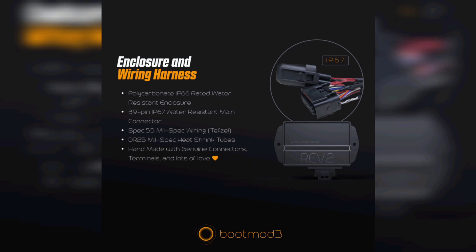They also increased the inputs and outputs, giving it a lot more capability for things it can control and data it can read to operate everything safely. It is IP66 certified, validating it for certain amounts of dirt and water intrusion — basically designed from the ground up to be mounted in your engine bay. Now, there are two things merging together here: the Rev2 board that does all the controlling, and the Custom ROM V2, which adds even more features and supports integrations with the Rev2 board.